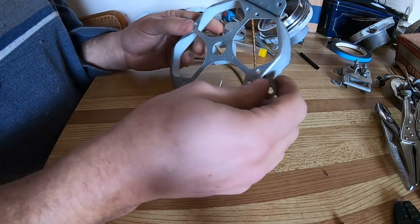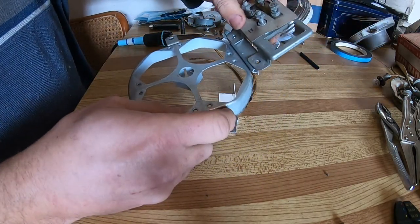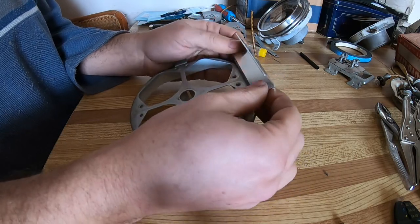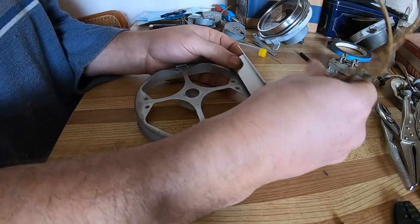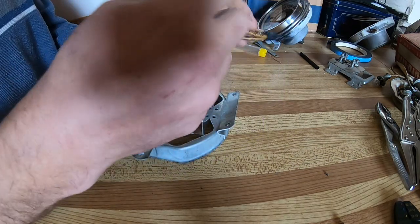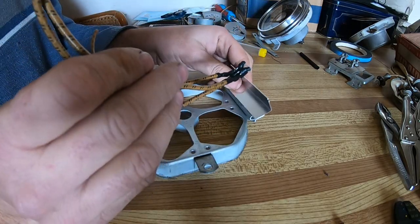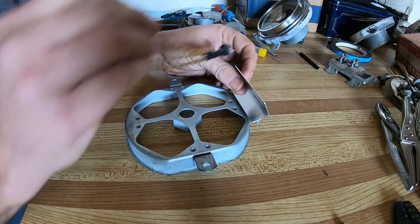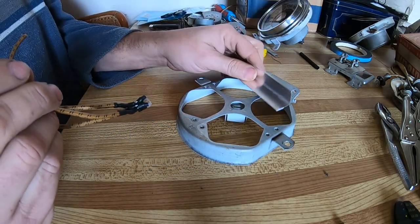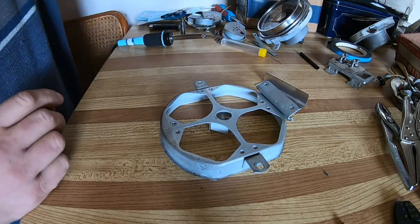this is the back of the gauge cluster. All the gauges go in there. This was attached to there. That was the circuit breakers. So what I'm going to do is drill 2 holes, screw that on there, and then this will get screwed into there, and these wires will go to the corresponding fuel gauge. And basically you could put 3 of them on this one heatsink, if you wanted to use the other 2 gauges that we are not going to be using.